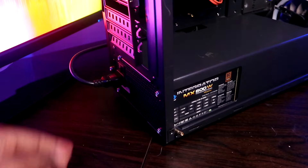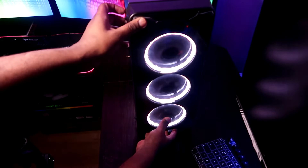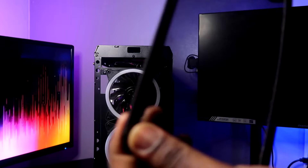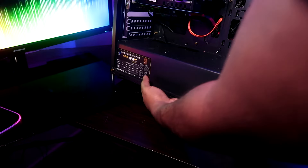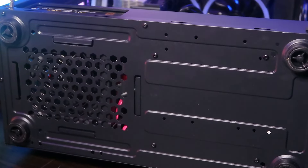After you've wiped everything, make sure you put everything back together how it was. Everything's nice and clean and you can pop your front panel back on, your side panel back on, and put on your dust guards. It's important to note that dust guards have a specific way to be placed back — the magnetic side is to be down. Make sure the dust guard that protects your power supply is always kept clean, because your power supply is one of the trickiest things to clean in your system. You actually cannot open it; all you can do is use compressed air, and you're not even advised to put the compressed air straw into the back of the power supply.